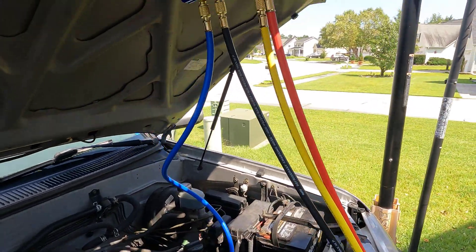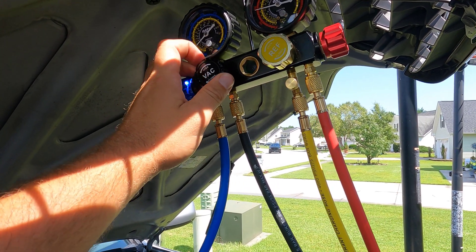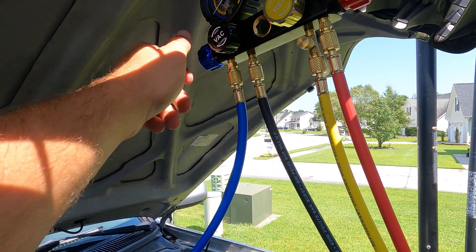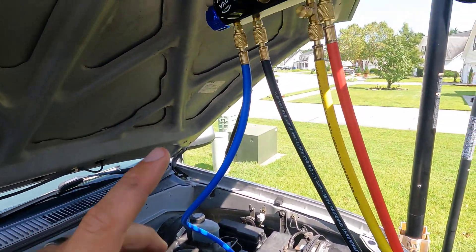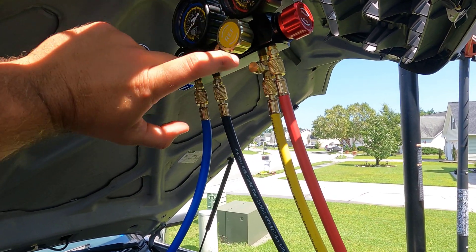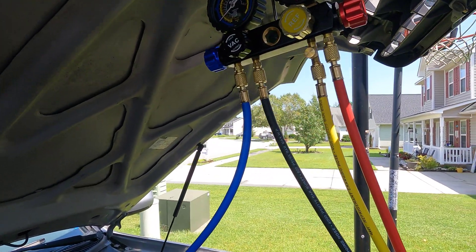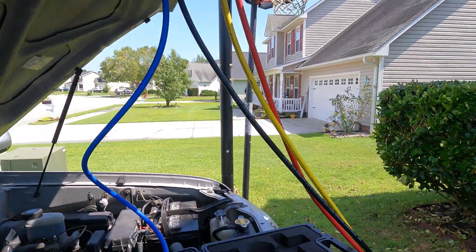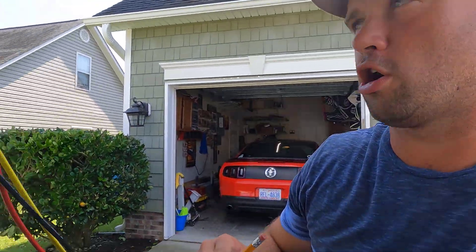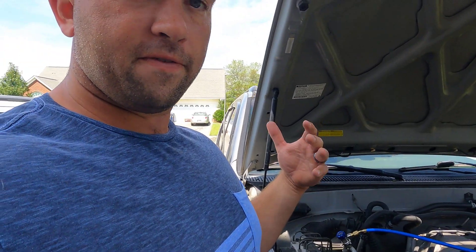That being said, if I did need to add coolant, I could easily draw a vacuum after it's drained by a professional — I could draw a vacuum with the system right here by opening this valve and the low-pressure line to draw the remaining coolant out and create a vacuum. I could also charge from the four-way valve by opening this and charge either high side or low side. The manual has you charging to the high side, however after speaking with Orion Motor Tech, they said you can charge to the low side. But since I don't need to do that today, we're just going to let it be. I'm going to go to the auto store, get myself a relay and a pressure switch just in case, and fix this problem.